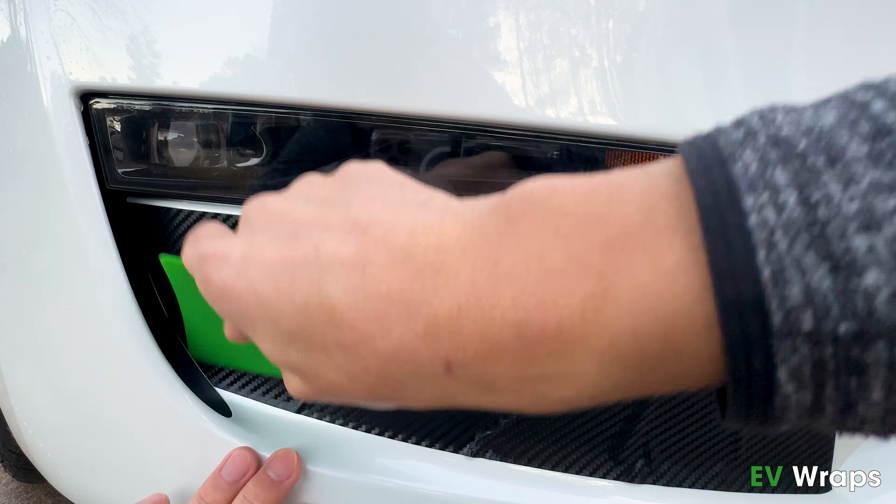Peel off a strip and tape it to the middle vertical vent plastic line, then tape it to the rightmost of the plastic line and all the way down. Separate 3 to 4 inches of the wrap from the backing paper. Align the wrap to the vehicle paint here and do not adhere past the strip. Carefully install the wrap so it covers all of the vehicle paint and does not surpass onto the black plastic. Install in increments of 4 to 6 inches with your hand.